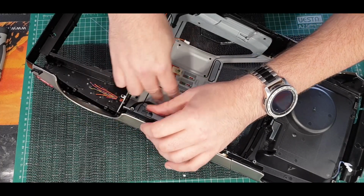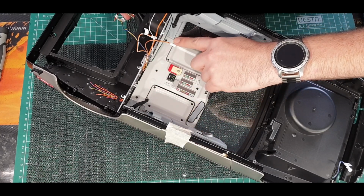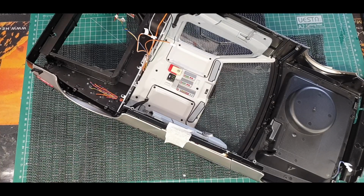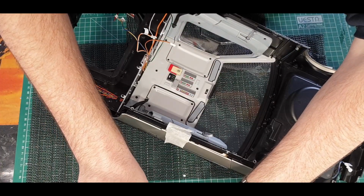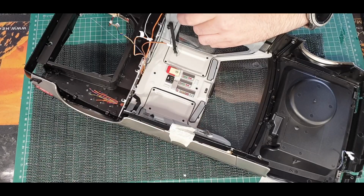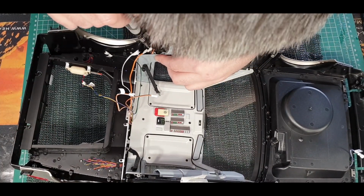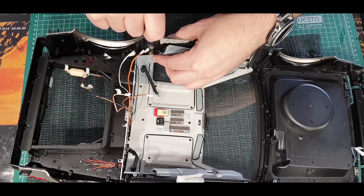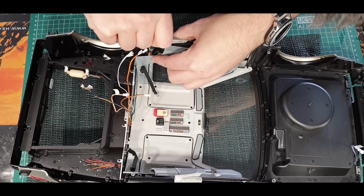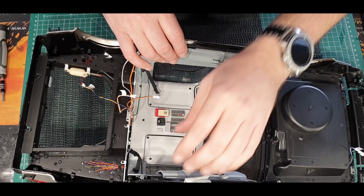So it takes a bit of a wiggle, but you can now see that that is now perfectly lined up with the roof lining. Same with this side here. Both of those are going to be secured in place with a DM screw. And as we're going into metal, a little dip of oil. So that's those 2 parts in place now.